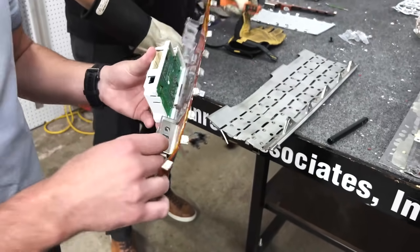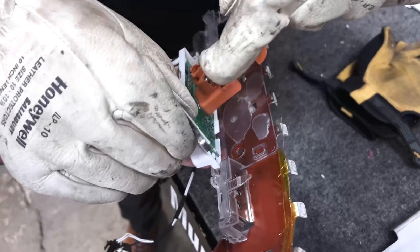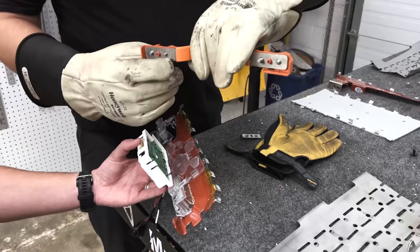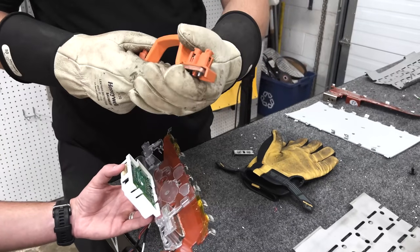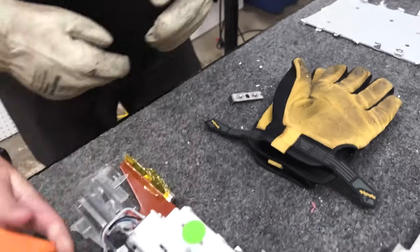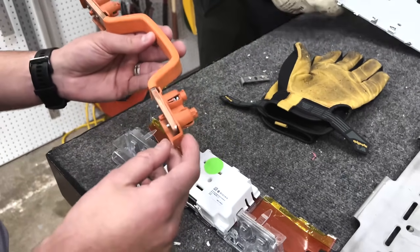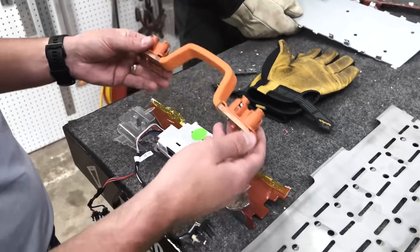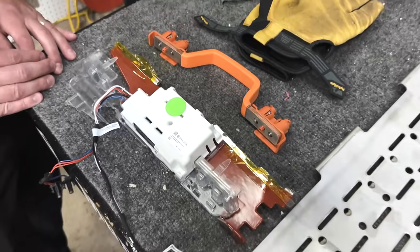The only spot that they did use threaded fasteners was bus bar to bus bar. There is a small fastening apparatus underneath the plate — these are a bit of a safety feature, a capturing container, so you just press up and the screw cannot fall out or get lost into the high voltage electrical apparatus you're working on. You may ask why couldn't they do a snap fit here — sure, you probably could have — but this is something where you absolutely want full connectivity and contact throughout the life cycle of the vehicle. You do not want any separation causing arcing. So anywhere they really want a good clamp load and positive connection, they use a threaded fastener. Where they can get away with snap fits, they took advantage of it. Kudos to Rivian for doing that.